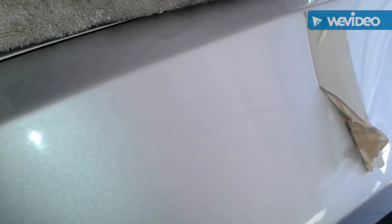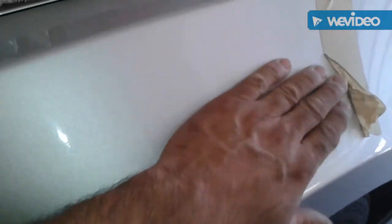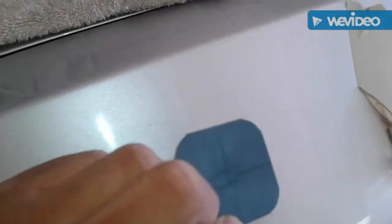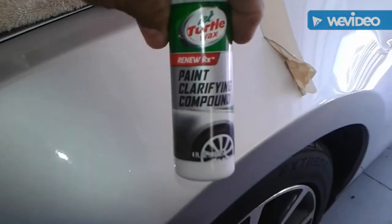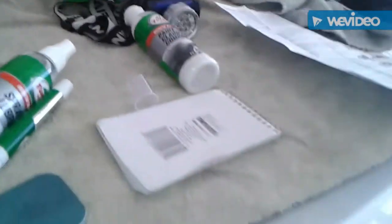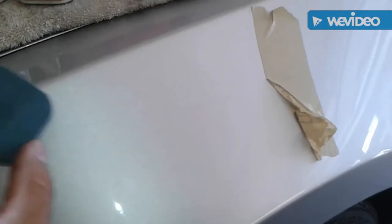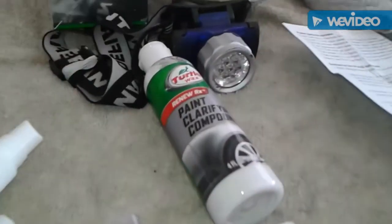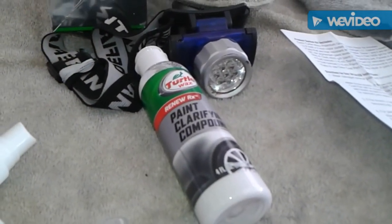It didn't really work a miracle like I thought it was going to. Once your sanding is done, always finish up with number four - the 4000 grit - because that's going to polish the clear coat. Number three might leave your clear coat foggy even after you use the rubbing compound or polish to bring the shine back. If you experience any fogging after polishing, go back with number four, wet it, sand it again, wipe it off, then re-polish and wax - that'll get rid of your fogginess.